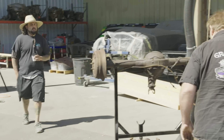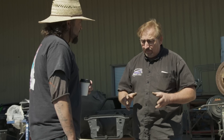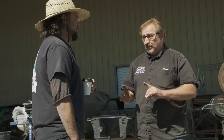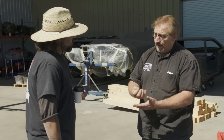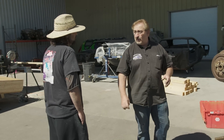Hey boss, I got the General Lee in the booth — do we know the color yet? Those cars were painted 1975 Corvette Flame Red. How do you have a Hemi Orange factory charger and say no thanks? It's a sin. They didn't paint that thing Hemi Orange. So I want you to look on the machine, Flame Red, 1975. I want to match it against the deck lid that came off of the car — rub a spot out on the deck lid. Ours should be a little bit redder than the one on the car because reds and oranges, when they fade, they turn lighter. But that's the color I want to go on the car to start with.